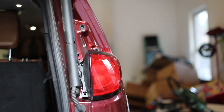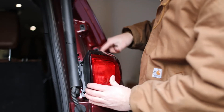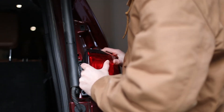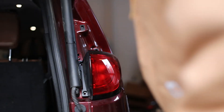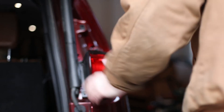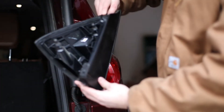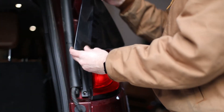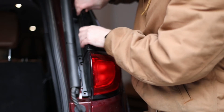Once you're satisfied that everything is working properly, you're going to want to go ahead and push this outer taillight assembly back into place with those two posts on the back side into the sockets. You'll hear them both click in just like that. Make sure it's fairly firm — it should still be held firmly in place by the two posts. Then do the same thing with the garnish: push it back in just the way you removed it, push it in firmly, and make sure you hear those posts click into place.